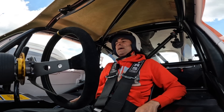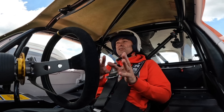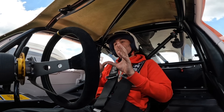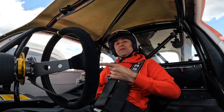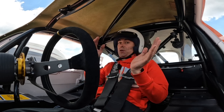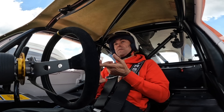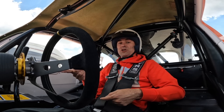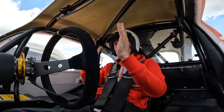Second run of the day — I'm going to make a few changes mainly around traction control. Previously traction control sensitivity was set to about 2; I'm going to set it up to 5 now, to be a bit more sensitive and hopefully catch that wheel spin as it happens. If it makes it worse, we'll go the other way and switch traction control off. The plan: big burnout on the rear tyres, put it back into 4WD, traction control on, set logging on, and then go.